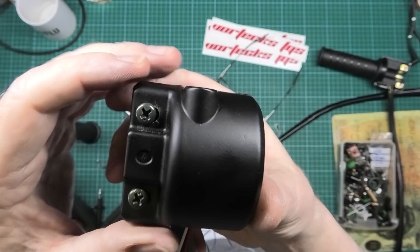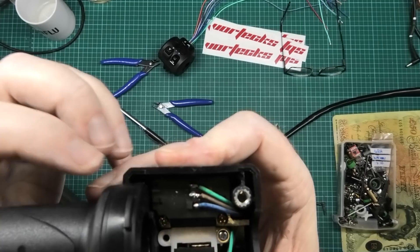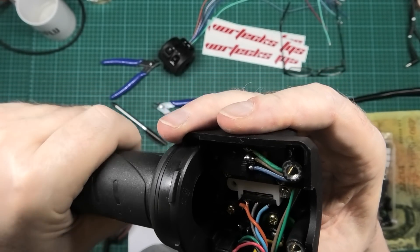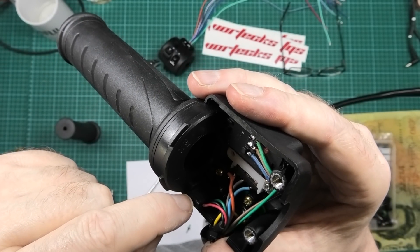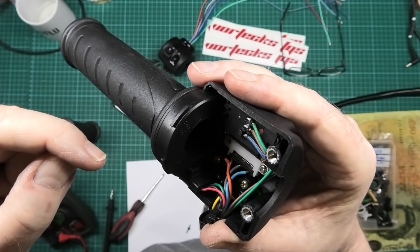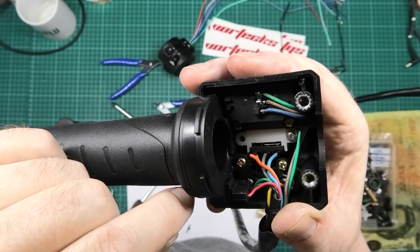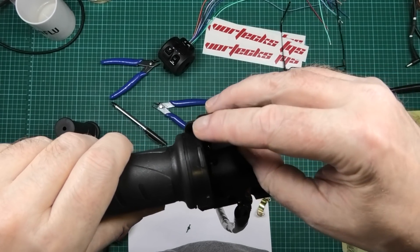Link in the description. The wiring's okay, not fantastic, and the soldering — it'll do, it'll work. This throttle is so smooth though, it's very nice. I really wanted a stop switch — the stop switch will enable me to have a separate variable regen on the Kelly controller. I know the Domino throttle has actually got a stop switch at the end, but obviously these are cheap things. Fantastic for the price though, absolutely brilliant.